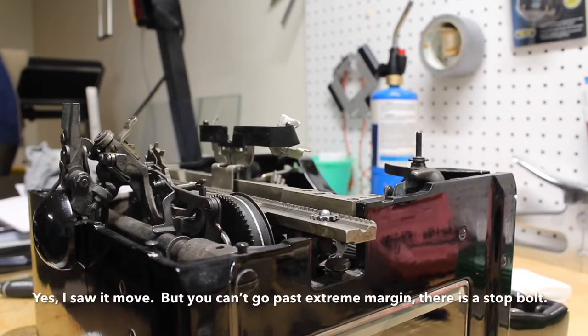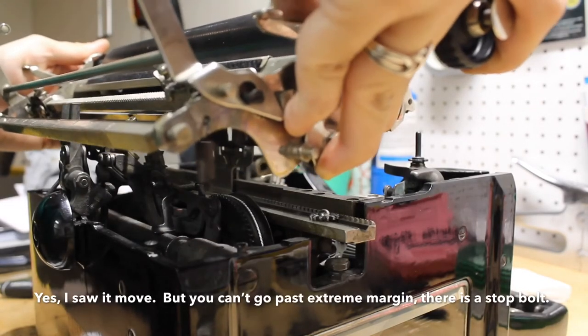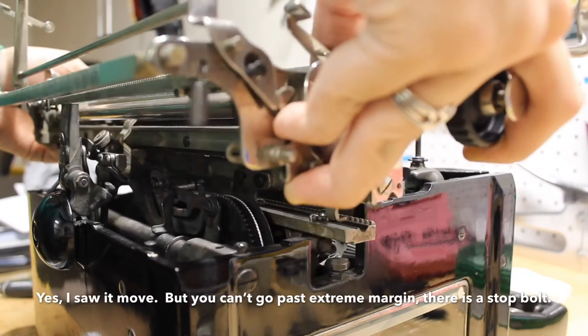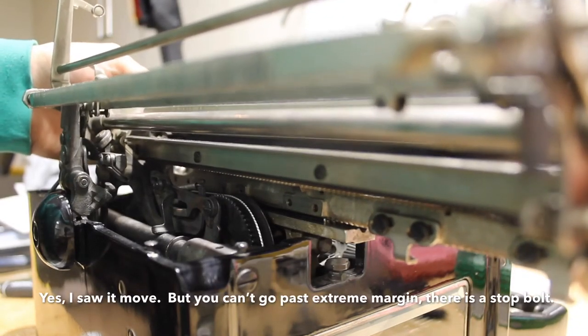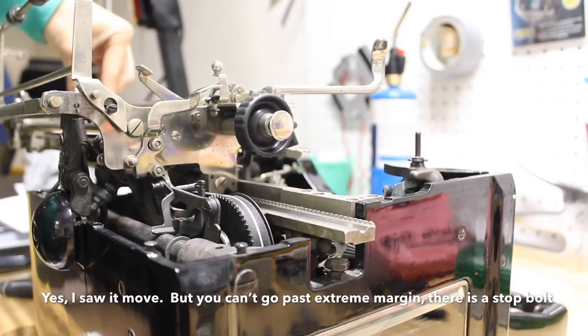From a lower angle: bring the carriage in, pitch it forward, slip the carriage rack underneath the upper bearing support, rotate it into orientation, hold it above the ball bearings, move it until you hit the margin stop, and then seat it firmly down on the rails and bearings and advance the carriage.